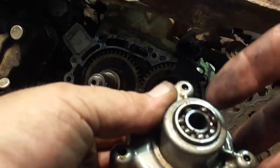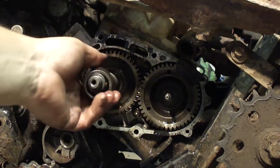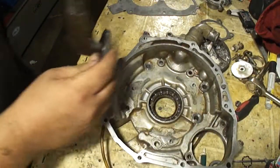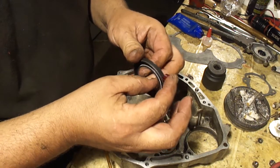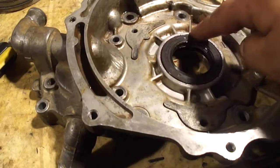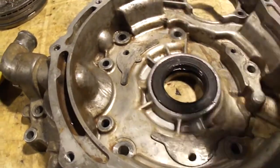The real good thing I'm taking this all apart — this bearing is bad. And there is the other seal. I'm just going to put some of this sealant on the outside of this seal. Just a little dab of grease in here. Now when you put this seal in, it will actually go down in this hole too far. So you got to be careful and only put it in so that it's flush across the top. If you push it all the way down, then the seal and the bearing will fail.